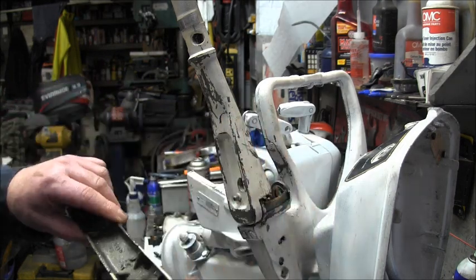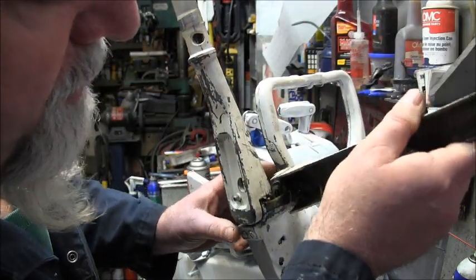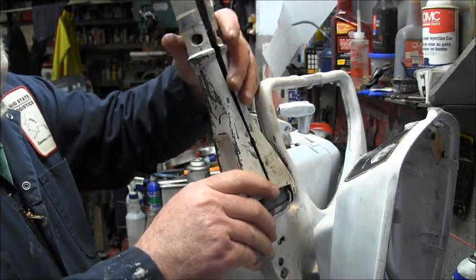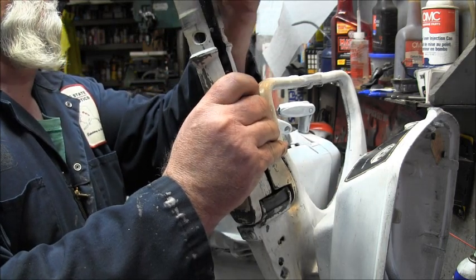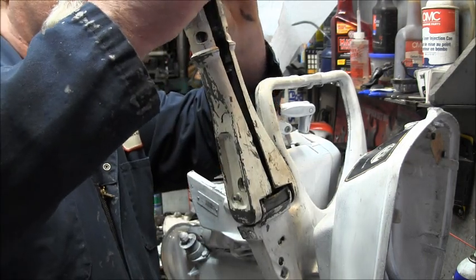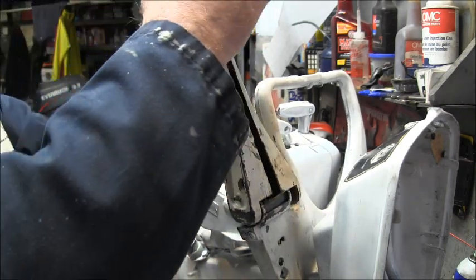Put the spacer there. Come in around this side. Come up. Raise it up like that toward the sky. Slide it down. And oh, this washer. The washer goes at the very top all the way up against the pin, and is to the outside of the handle.